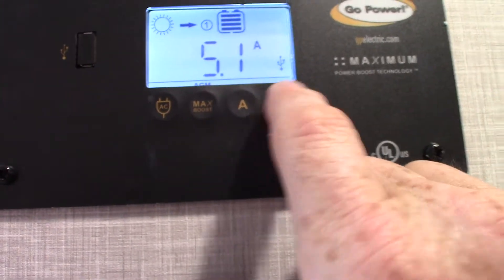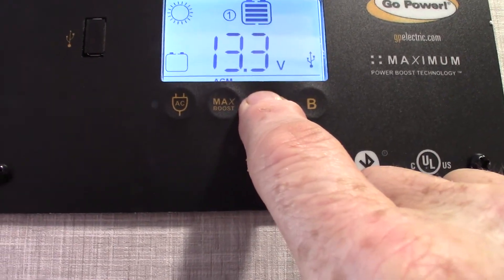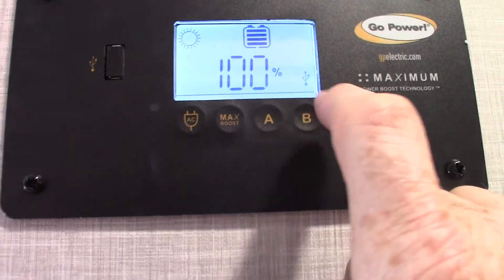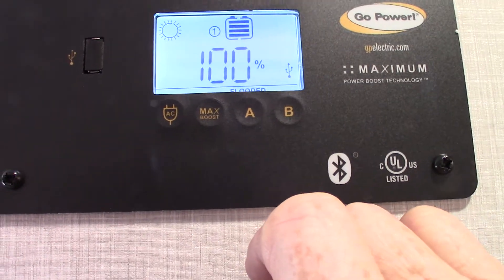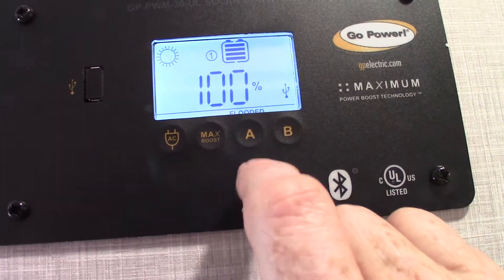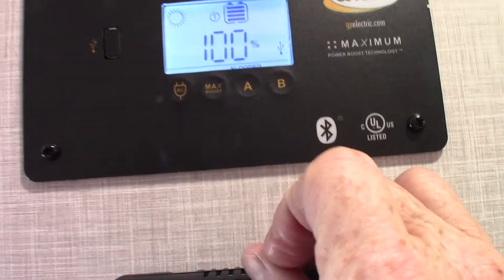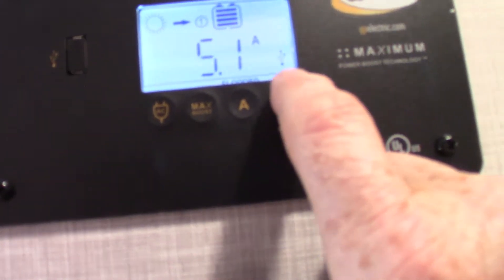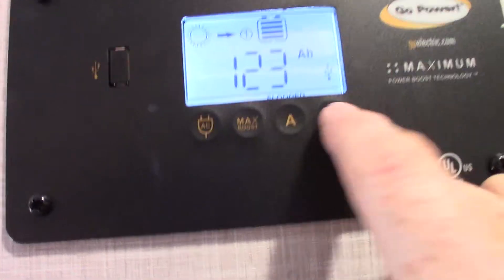Right now it says AGM battery on the panel, but it's actually a flooded battery. These batteries are kind of sealed but you can pry the caps off — they have electrolyte and distilled water inside. So we go to 'flooded' in the settings. Once you set that you don't have to do it again. So: 13.3 volts at your battery, gaining 5.1 to 5.2 amps from solar. This is the thermostat — it's an analog thermostat. You want the fan on auto. Heats to the right, cools all the way to the left, one click back to the right is fan — the air conditioner running without the compressor, just circulating air.